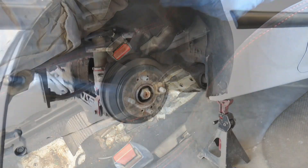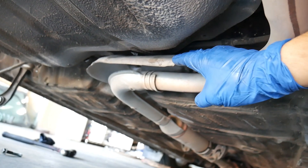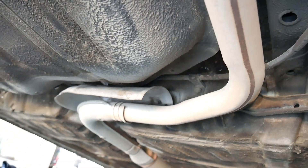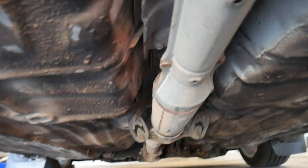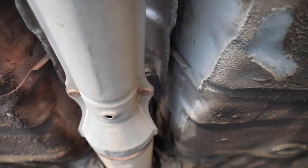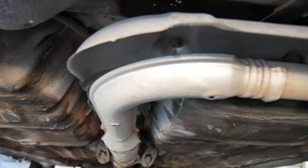Now let's get underneath the car. We're going to start on the passenger side because it's the most difficult of the two. The reason it's a bit more difficult is we have to remove the heat shield around the exhaust — this heat shield blocks the path for both e-brake cables where they enter the body of the car. You have four bolts: one in the back (10 millimeter), one right here, and at the very front one on each side. Remove all four and pull the heat shield out of the way. You don't need to remove the exhaust — with extensions on your ratchet you can reach all four bolts.